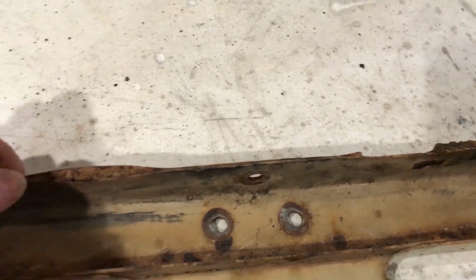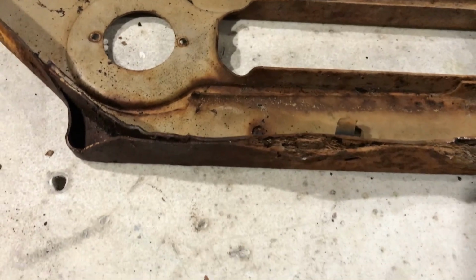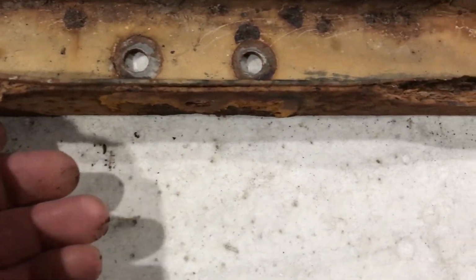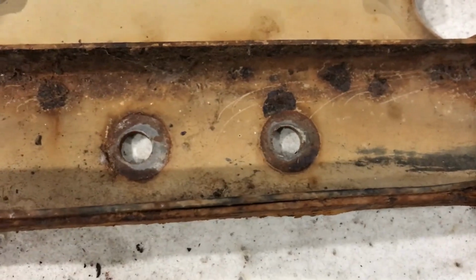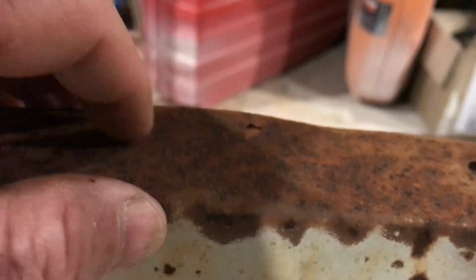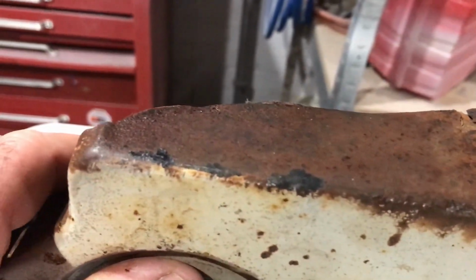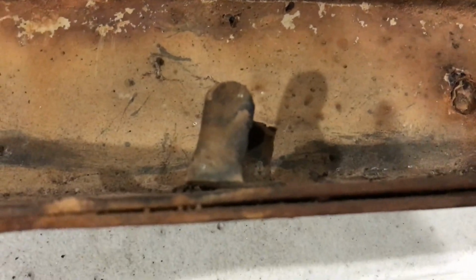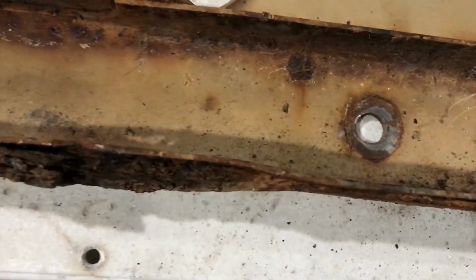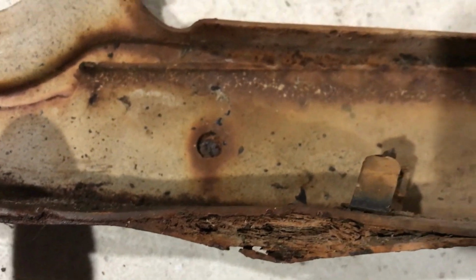Might have to cut the outside section off and then repair, put a few patches on the inside section, or it's pretty thick too, or cut them both right off on the fold, because the front part is not so bad. So cut them on the fold or just on the other side of the fold, so there's pretty well no distortion, and just put, I don't know, it looks like it's pretty thick, a 3.5mm or just a single piece through where there's no sandwich. Sort of be better. Lose a bit of the authenticity, but it'd be better.